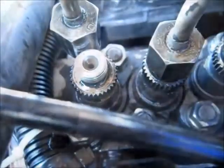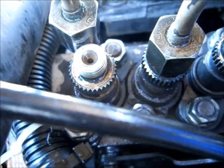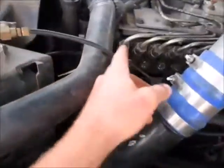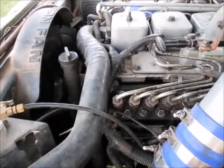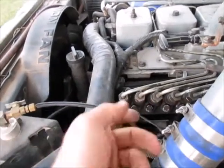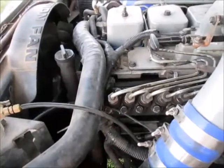So just maintain that same little stream of air every time you do it. I like to see it just whispering out — kind of swirling, not shooting, just a wisp. If it stops and you can't see it anymore, just disconnect your air compressor, plug it back in, and that will vaporize more fuel again so you can see it coming out. It's really simple.